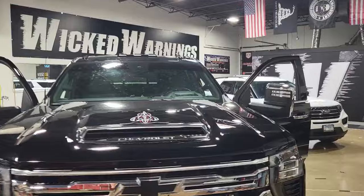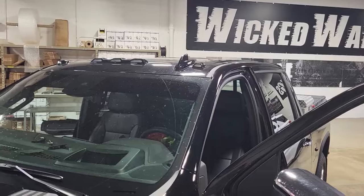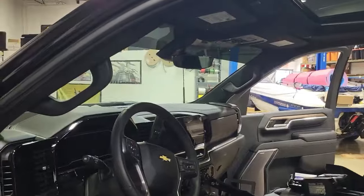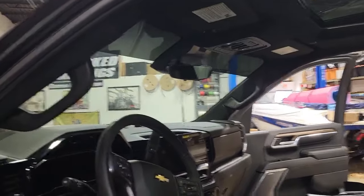This is going to plug and play behind the driver's side A-pillar for the three-piece General Motors Roof Lights. It's going to fit a whole heck of a lot of three-quarter ton trucks. Won't fit any half ton trucks because they typically do not have these. So this is going to be all your 2500-3500 Sierras and Silverados and even some of the upper 3500-4500 trims as well.